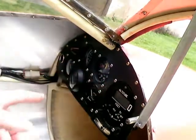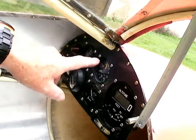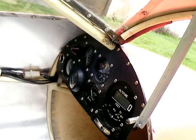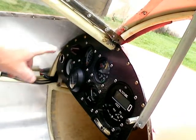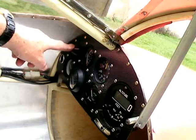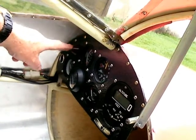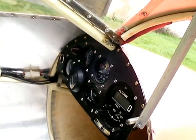Even with the flaps down, you can slow it down to an indicated 20, but I don't think it's really going 20. The angle of attack is so great with the flaps down that the air is not hitting the pitot tube right. You're going pretty slow, but not that slow. This is the light that comes on when the fuel transfer is on — this would work if that switch under the seat's working, then this light will glow red so you don't forget that you're transferring fuel.